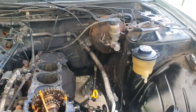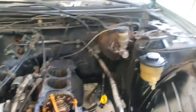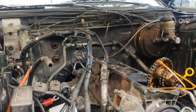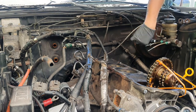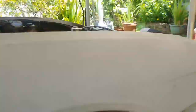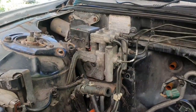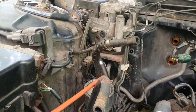I don't have anything to drain my brake master and it's dirty. Now that we got those hard lines loose, we're going to disconnect the hard line that leads to the front right brake, pull that hard line completely out, and then start working on the ABS module — pulling that completely out.